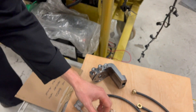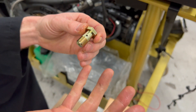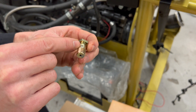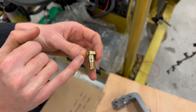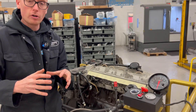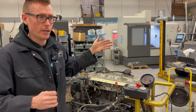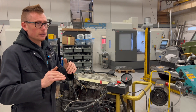What you have to do if you're running a Bosch 044 or similar — to prevent creating high fuel pressure — is enlarge the outlet hole in the banjo bolt. I believe it's 2.5 mm — just get a drill bit, slide it in there, drill that out, then use a countersink to make them both neat, and blow the airline through. Using a 2.5 mm drill bit will usually drop your overall fuel pressure to around two bar. You could sneak it up to 2.5 bar — that's not going to cause a problem — but you don't want to go up to three bar or higher with any pump. Lower fuel pressure is better, as long as you can maintain that lower pressure.